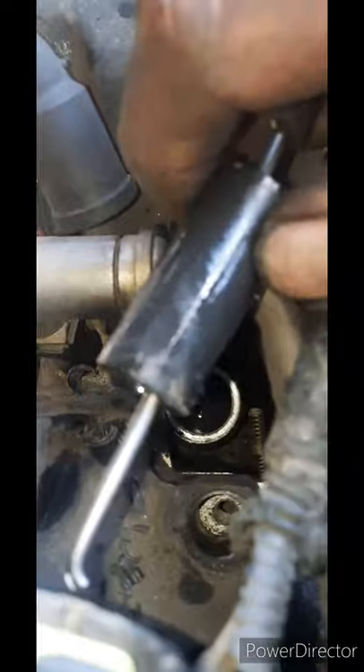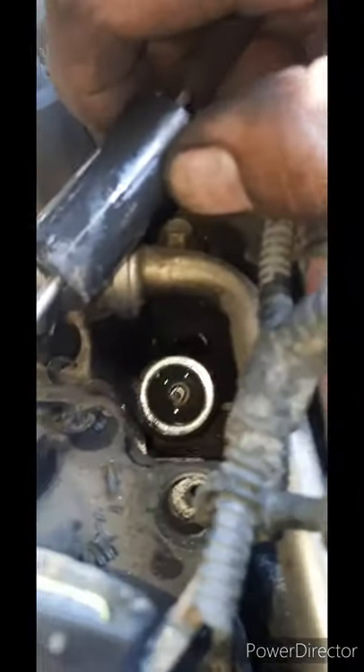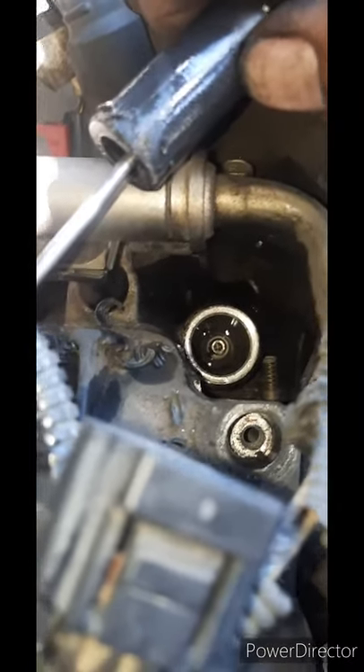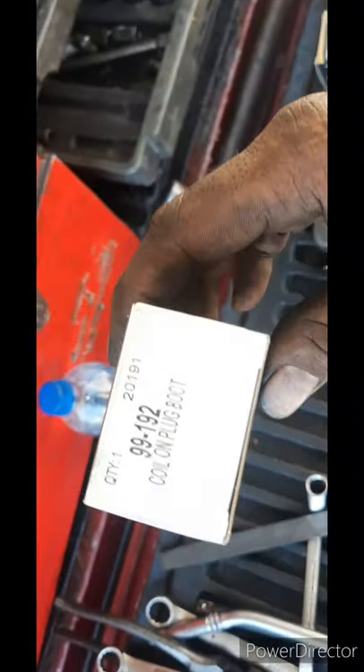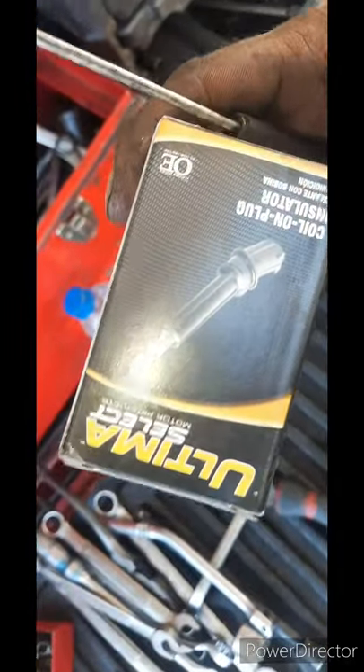At this point I'm not even being gentle trying to salvage them — I just ripped them out because trying to do it carefully on one side didn't work. It was just frustrating. I lost like three hours just trying to do spark plugs, and this is the reason why. So get that thin wall 5/8 for sure. You can replace the boots — I went to O'Reilly's. They come with a little spring in the middle as a coil contact for the ignition coil.